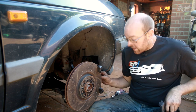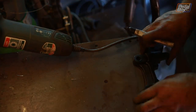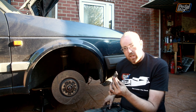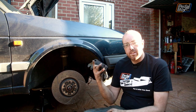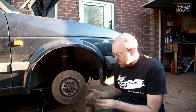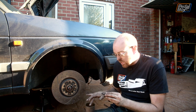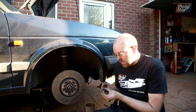I've marked out the size we're going to need and tested it in the back for thickness — 3mm is surprisingly close, so I'm going to make two of these, clamp them down and see how close they get. 3mm wasn't quite enough; it was still hitting the inside when fully tightened down, so I've welded two pieces together with a couple of spots. It's going to be in compression so it shouldn't have a lot of force — it'll just fit on the back of the caliper carrier and bolt onto the back of the hub. Before I put the bolts in, I'm going to put some copper grease on, like I did last time, because that made an enormous difference getting these loosened. One bolt was oddly tight because the copper slip was further up the thread rather than where it actually sits, which is no good.